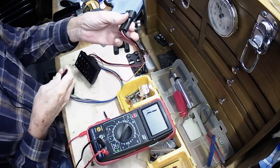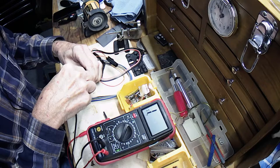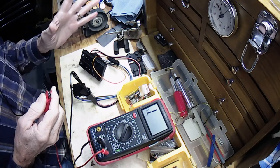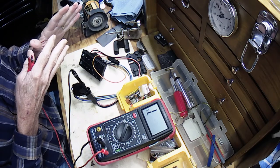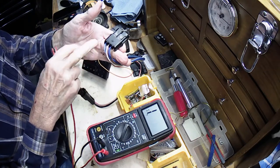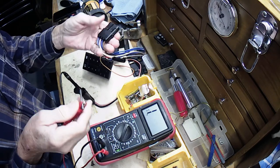This wiring harness — the red and black is power and ground, pretty much obvious. I want to connect it to the ground. What I'm testing for first is the normally closed position of the switch. With a good working switch in the normally closed position, all of the wires that go to the up and down passenger and driver's side will test a short to ground.